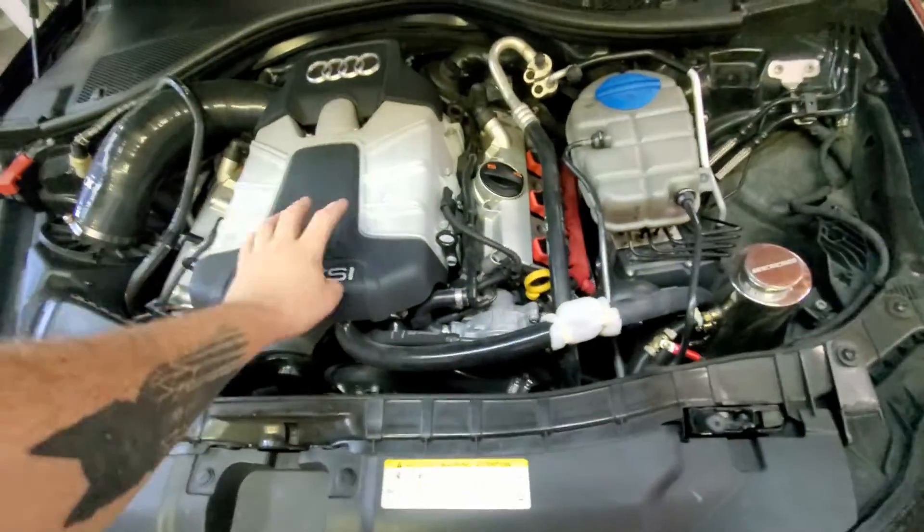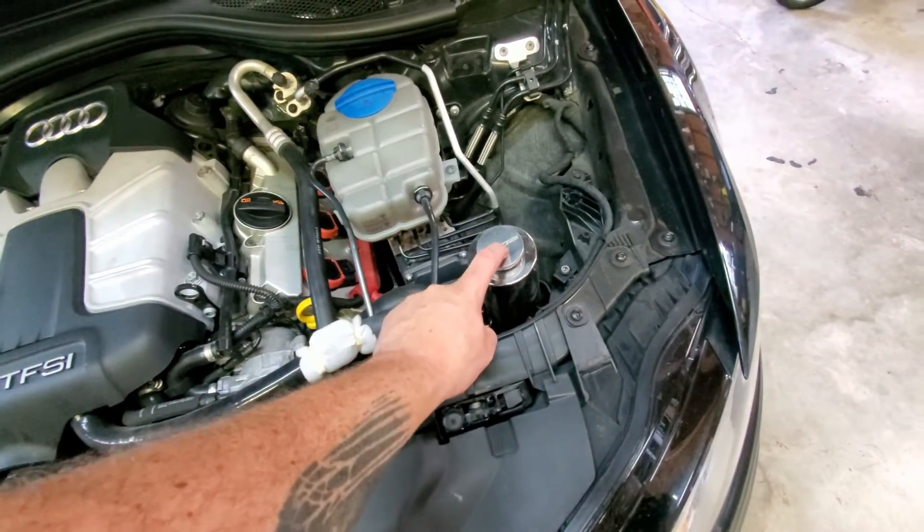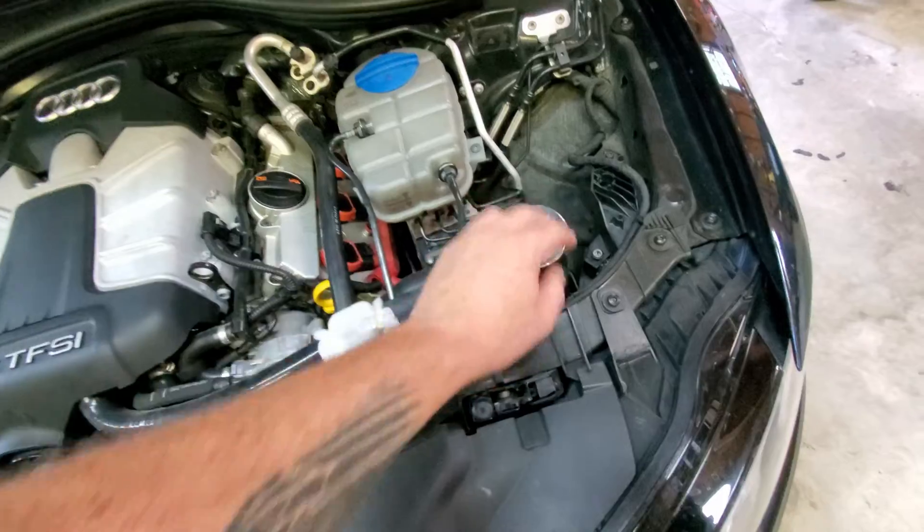I hope you found this video informative. It's pretty easy to diagnose your typical misfire on these cars - usually it's the spark plug, the coil pack, or the intercooler core. Beyond that, if this doesn't fix it, you might have oil seeping down into the combustion chamber or a failing catalytic converter. Unfortunately for me, I just got back from my test drive and the misfire stayed in cylinder three - so that means I have a leaking intercooler core. I verified it another way as well: because I have a divorced reservoir for my supercharger cooling loop, I checked the volume of water and it's lower than it should be. With no visible leaks anywhere, that means it's coming out through the intercooler core into the combustion chamber. So I've got to swap intercooler cores.